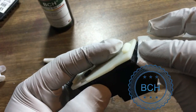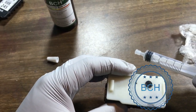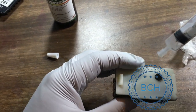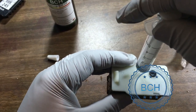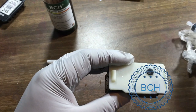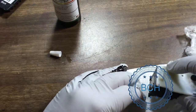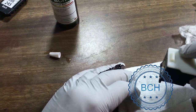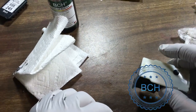Clean the electronic ribbon. For first time usage, we need to remove air bubbles from the bottom of the print head. Use the flat priming syringe and blow up to one millilitre of air into the air hole, which is the little hole on top of the black refill plug. Ink should run down from the cartridge. Use a paper towel to dab and absorb the excessive ink — do not rub the print head. A gentle dab is enough. This method is also useful to remove clogging in the future.